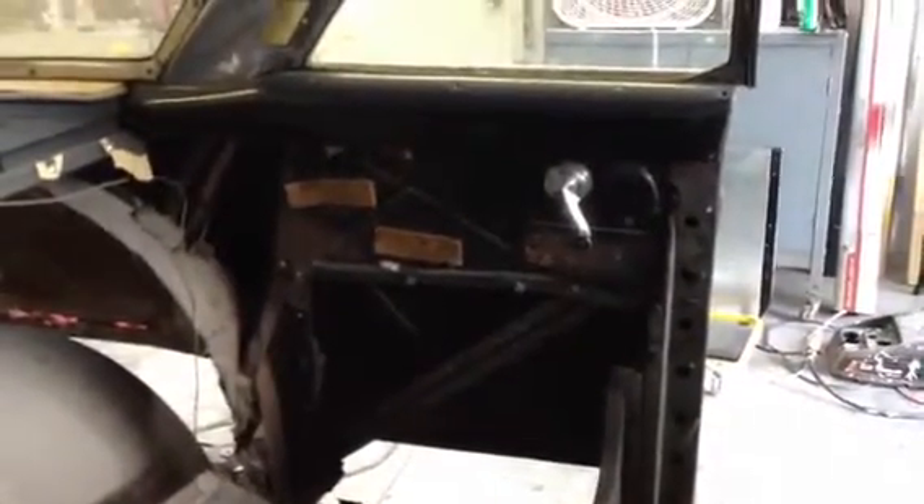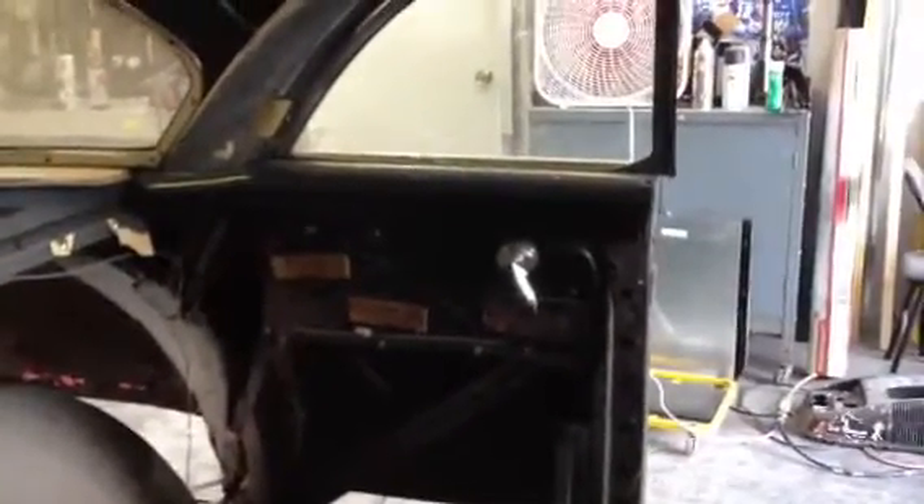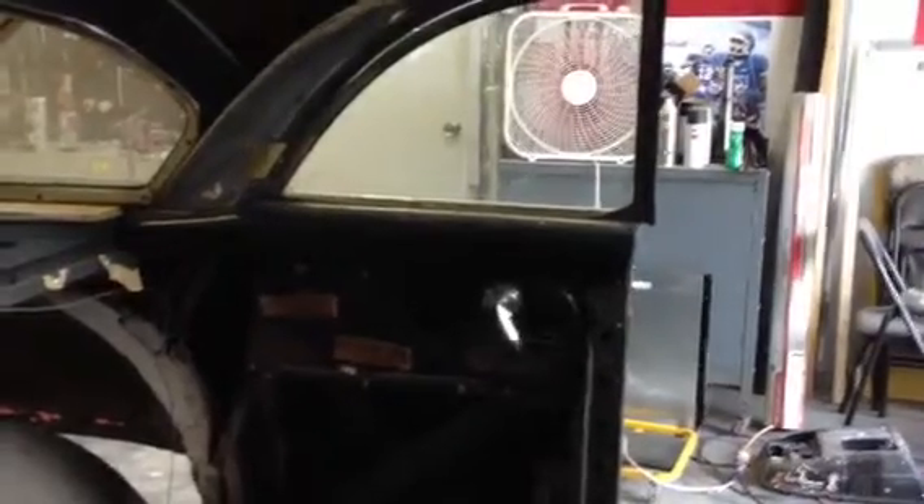Last night I took that whole door apart. There's a hinge inside of here that this window rotates on when it goes up and down. The hinge inside, that this hooks to to pivot, was frozen up on that side. I had to take it completely apart and unfreeze the hinge. Now it rolls up and down just fine until it hits the spot where there's a missing tooth in the gear, and then you gotta help it up a little bit, and then the tooth catches again and it keeps going.